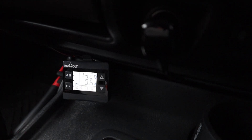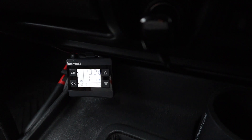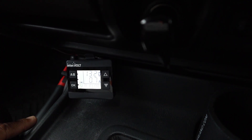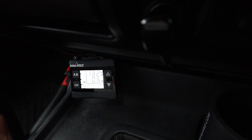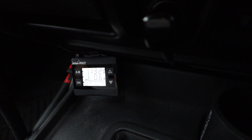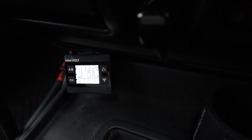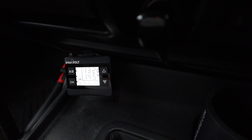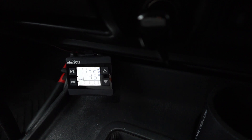Here's the little LCD display that comes with the DC-to-DC charger. You can have it installed just about anywhere on the dashboard that's convenient. In my case it's tucked away neatly next to the gear lever facing upward so I can glance at it while driving. At the moment it's telling me my auxiliary battery is at 13.2 volts and the DC-to-DC charger is pumping in 0.6 amps — that's all it needs to keep it at optimum. The icon at the top, which looks like a cell phone signal indicator, tells me the auxiliary battery is full and just getting a little top-up. Toggling the switch shows the auxiliary battery volts on top, and 14.5 volts — my main battery's voltage — on the bottom.